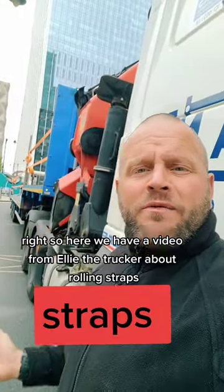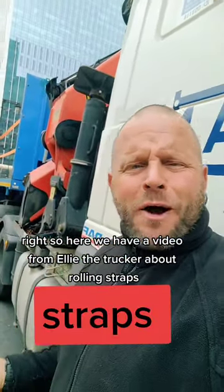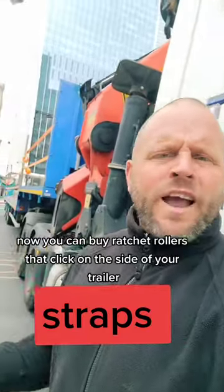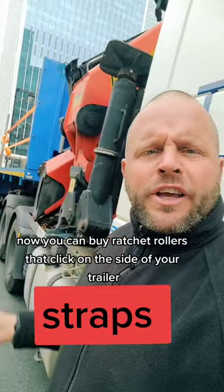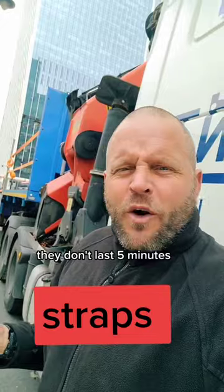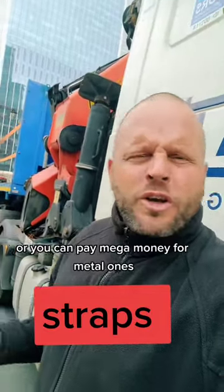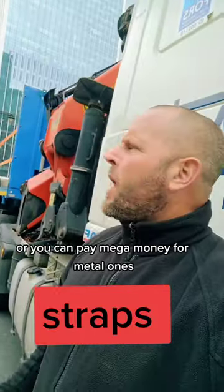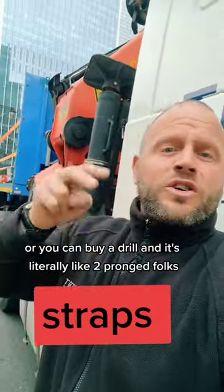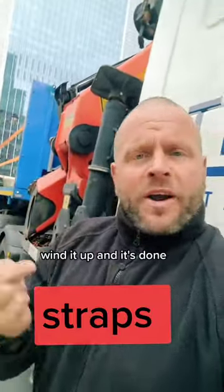Right, so here we have a video from Ellie the trucker about rolling straps, and she wants to do it a little bit faster. Now, you can buy ratchet rollers that click on the side of your trailer, you feed the strap in and wind the handle. They don't last 5 minutes, they usually break, or you can pay mega money for metal ones. Or you can buy a drill, and it's literally like two pronged forks. You put the strap in a drill, wind it up, and it's done.